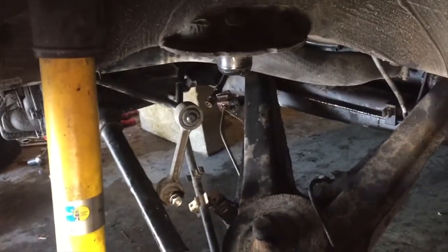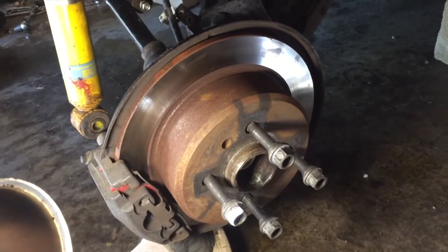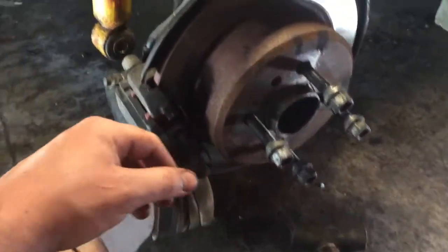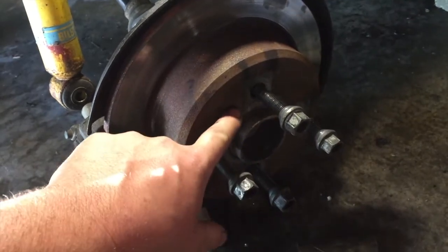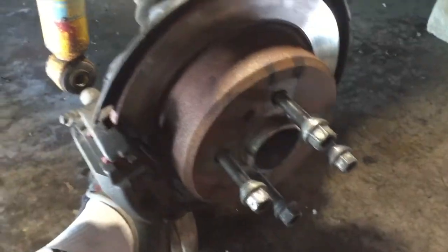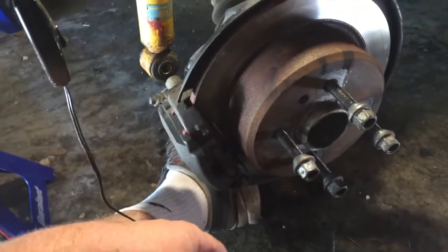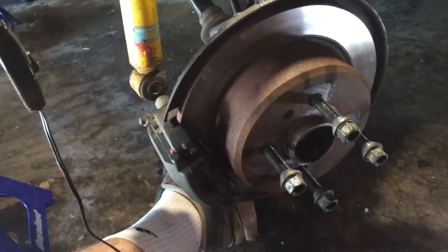So right now, because I have to take off the parking brake cable, I'm going to be disassembling the whole brake assembly here and getting at what's underneath this rotor. Alright guys, so I figured I'd show you how to rip off this caliper and rotor here. So I don't rock this set screw if you have one. Sometimes they strip out. I don't suggest reusing them, just leave it off. Put some studs on, they're cheap. Not much play here, it's nice and easy. But on the back of the caliper here, there's some bolts, they're 17mm. Rip those off. Don't mess with any of the other bolts. Don't take the caliper apart. When you put it back together, you can just stick it on there and go, and it won't be a hassle, you know. So, mint.